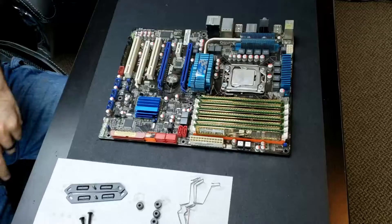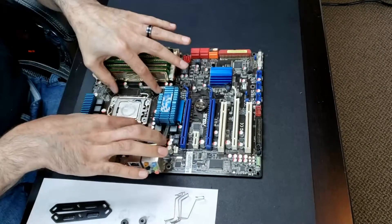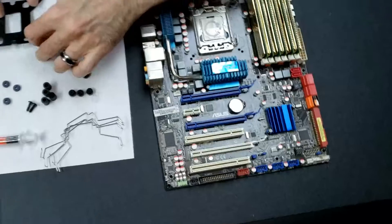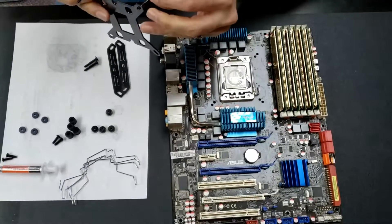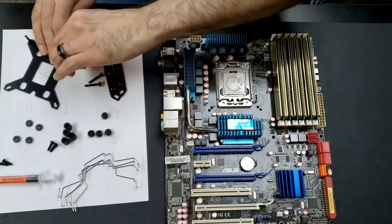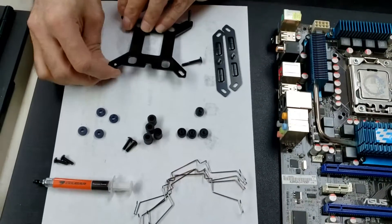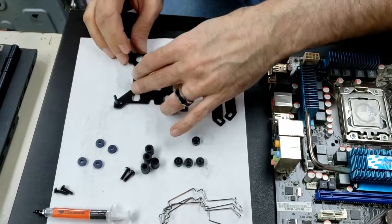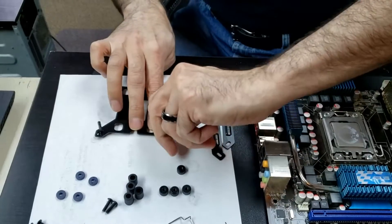I'm just going to carefully pull it out, watch these cables, and get the motherboard out of there. Now we can just work on it right here on the desk. So, I took out of the kit the Intel bracket for the back side. They've got these screws that pop into the top notch and you have to rotate them a certain way so they lock into that little notch — it only goes one way. That way, when you're tightening the screws, these studs won't just keep spinning. We're going to take this bracket and put it on the back side of the motherboard through these holes here.